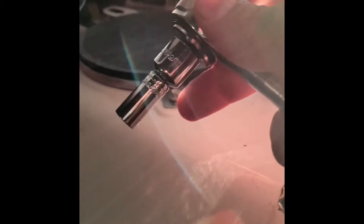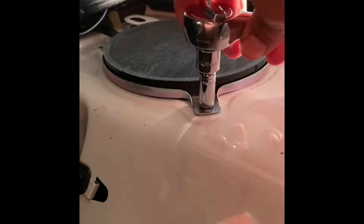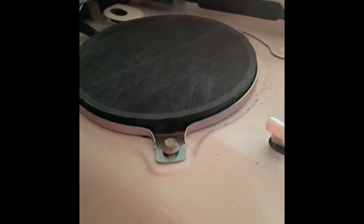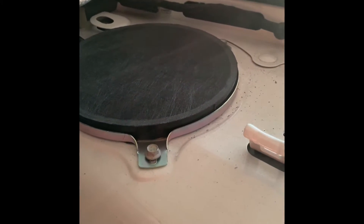Once you get back into the speaker here it's gonna be an 8 millimeter. Go ahead and loosen the three bolts up. Then match up the bolt pattern on the aftermarket Kickers that we're gonna install. Pull this one out — hopefully we'll be back with some more thumping, louder, clearer, crisper, amazing sound.